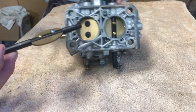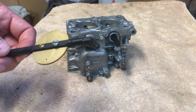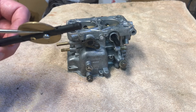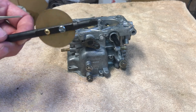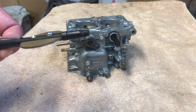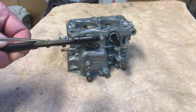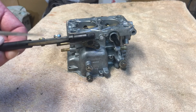This is a DCOE shaft so you can see what I'm on about. The original Weber screws are quite large if you look at the cross-sectional area in terms of airflow, and this is a replacement for the Italian ones — you can see they are much closer to the shaft and don't protrude as much. These are better for airflow because there is much less cross-sectional area compared to the original.